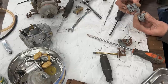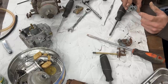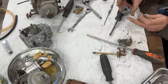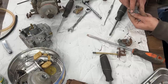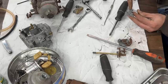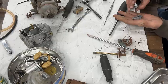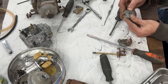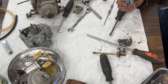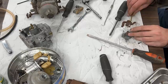There must be a valve missing here — I think it's a diaphragm that gets pushed by this spring. Surprisingly this one is not adjustable; the early ones have a slot so you can adjust this valve. This is actually a throttle bypass — sometimes this valve gets stuck open and then you have problems with high idle. I'm going to take this apart and come back.